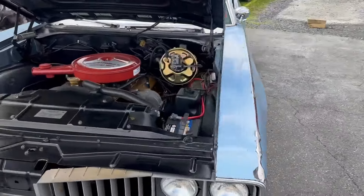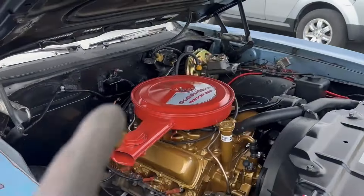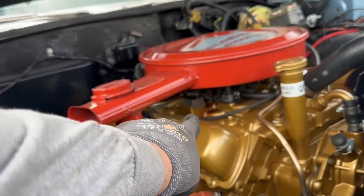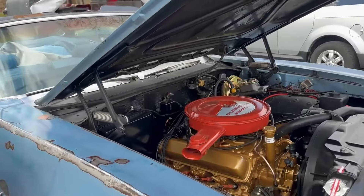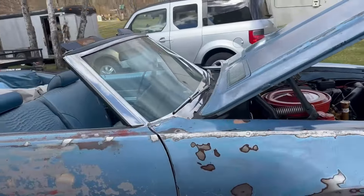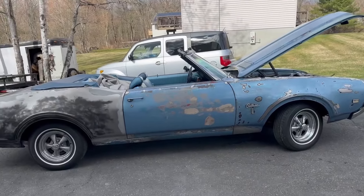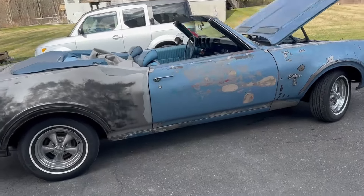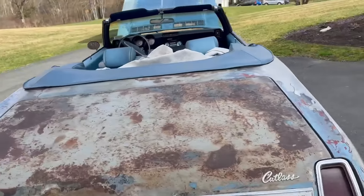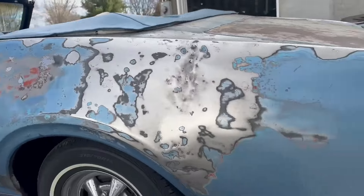There it is — as easy as that, and it should be that easy because we certainly have our fair share of time invested in this car. The choke is just too aggressive. It still has the original heat stove on the intake, that thermostatic spring, and there are three detents in the carburetor where you can set it. I thought I'd have it in the middle — I might have to relax or even bend that rod. You heard the thing almost wanting to kick over without me even touching the gas pedal, like it's fuel injected. That's all well and good, it sounds good, it went right into reverse, the brakes work, and I think we'll let it warm up. We'll check some fluids and then we will take it for a ride.